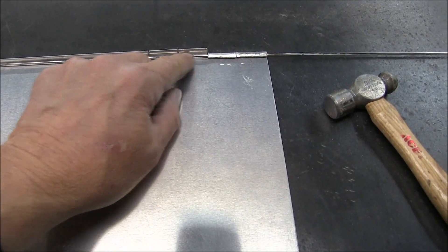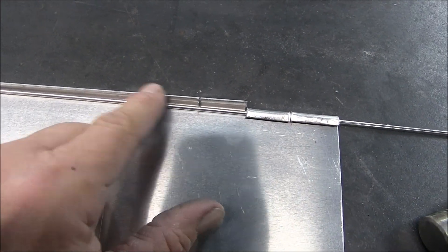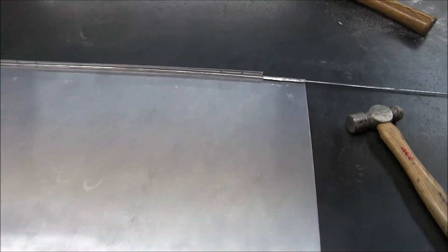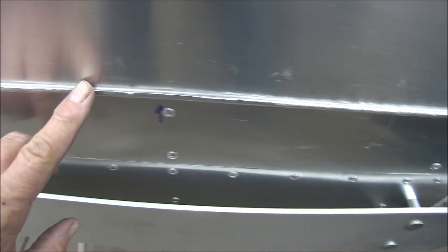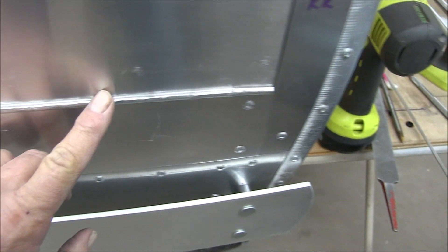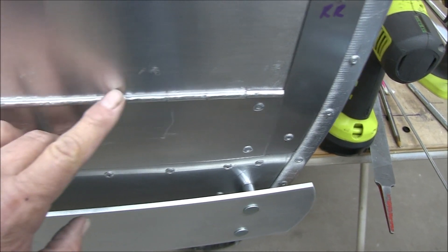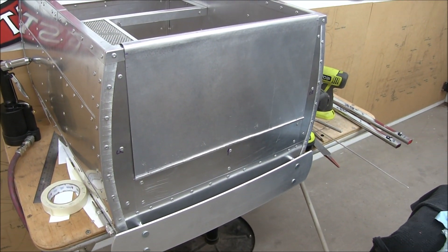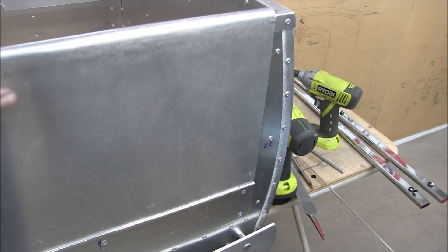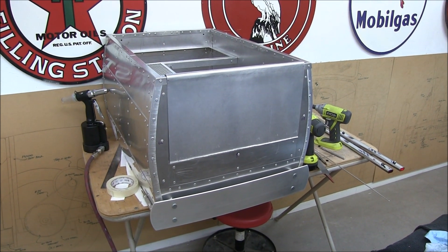Here I'm hammering the bottom edge over a piece of aluminum welding rod, creating the look of a hinge. It seems to be going alright. I'm pretty close to having this one done — you can see where I've hammered it over. I'm starting to finesse it using a hammer and a punch trying to clean it up, and with a little bit of work I can get that to look smooth and decent. That will emulate a hinge line, and I'll put just a few rivets in it to hold it in place because I want to keep it open for the Studebaker decal.